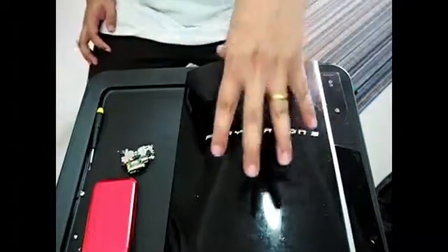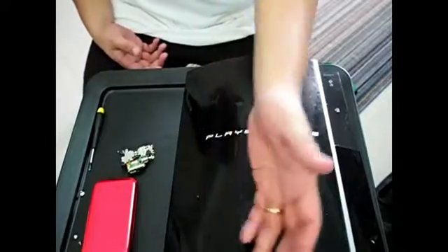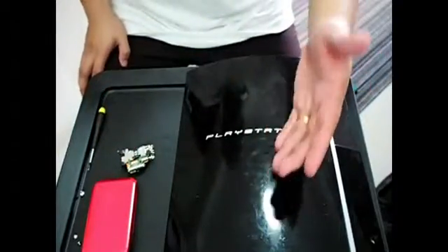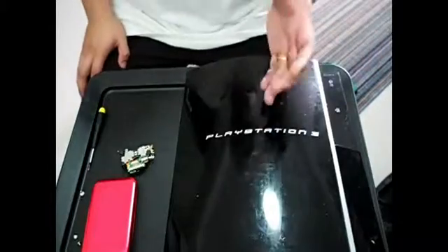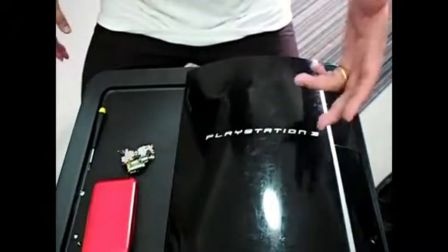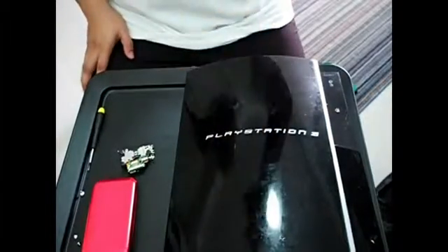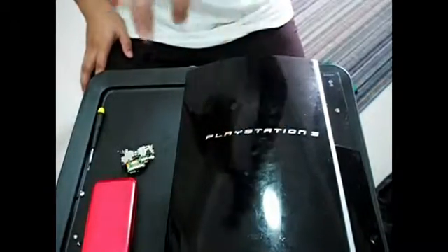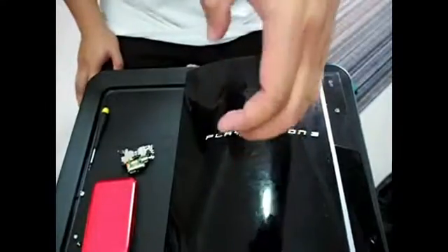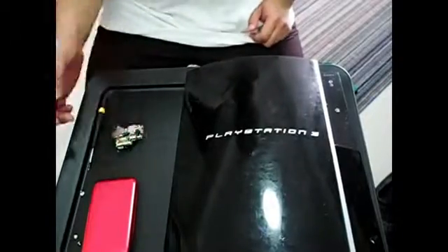Don't be intimidated by it. When you boot it up, the PlayStation 3 will recognize that it's a new hard drive and it will install the operating system. I highly recommend you already download the latest firmware for the PlayStation 3 onto a flash drive from their website, so that after the PlayStation 3 installs its operating system, you can update the firmware right away and play your games regularly with an upgraded hard drive. If you want to improve the performance of the PlayStation 3 — especially loading times — go ahead and buy an SSD. The PlayStation 3 is compatible with an SSD, including the PS3 Slim and Super Slim.